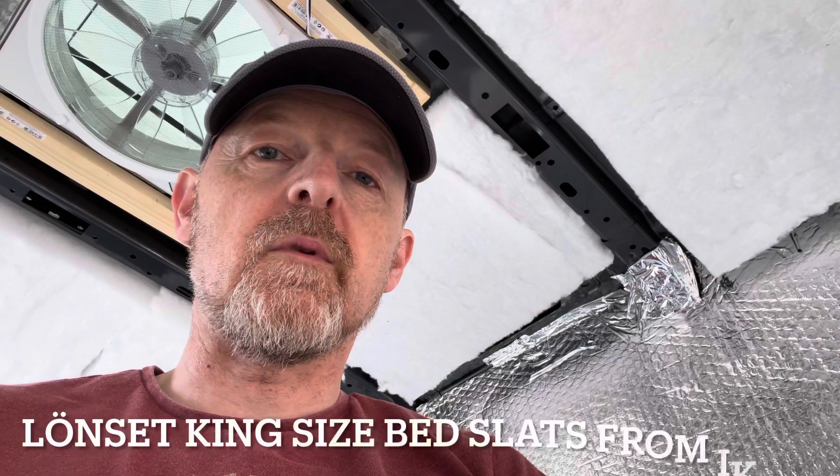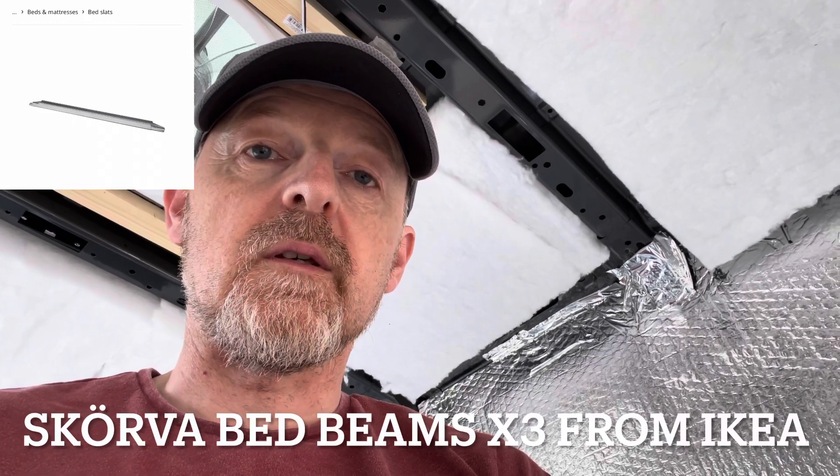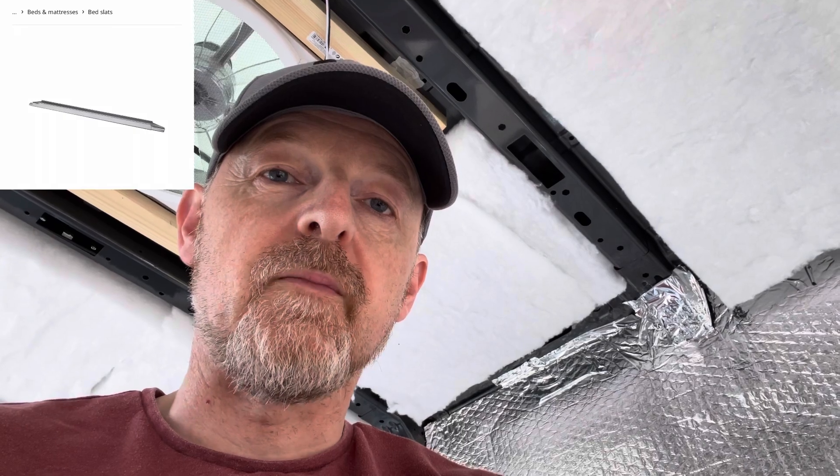Good morning YouTubers — we're progressing today with the bed frame. We've got the side panels cut to shape going around the brackets at the back, as you can see from the previous pictures and video. I've marked off the holes I'm going to use to put the M6 bolts and lock nuts through to hold it, and I'll use sparingly some self-tapper screws in certain places where I can't get a bolt through. The bolts will make a good secure fixing for the bed to mount to.